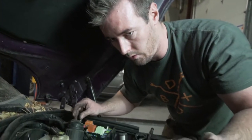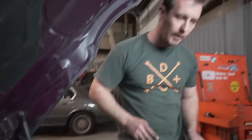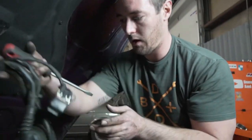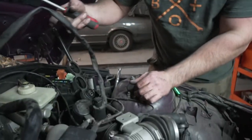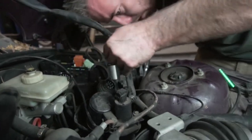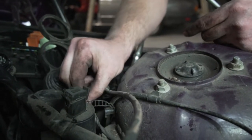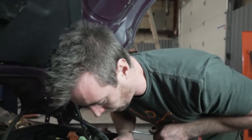So you've got one for your starter and alternator, one for your ECU, and one for your fuse compartment. Going back to the trusty standard screwdriver, you've got another relay right here — same system. Just stick it in right here, pry that way. Then you can see all that is off — easy. After you get that stuff off, just follow this loom forward. You can actually undo these without breaking them — the proper way is there's a forked connector on the other side, you want to pull backwards and up, and this will slide off. You can actually reuse these.